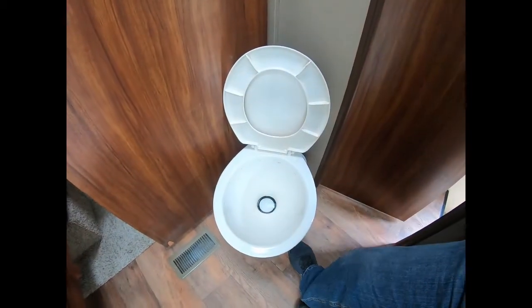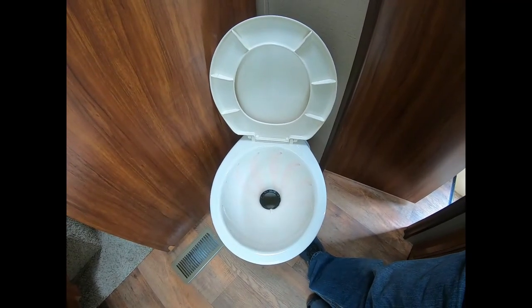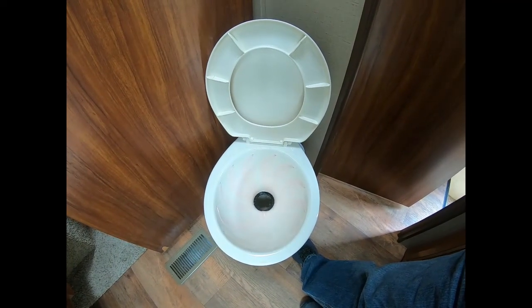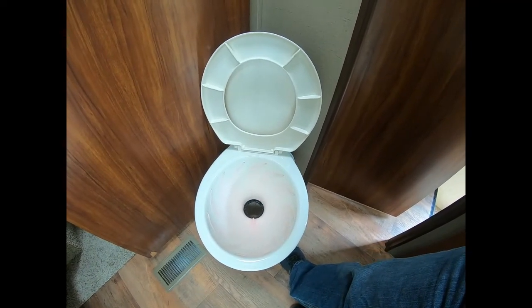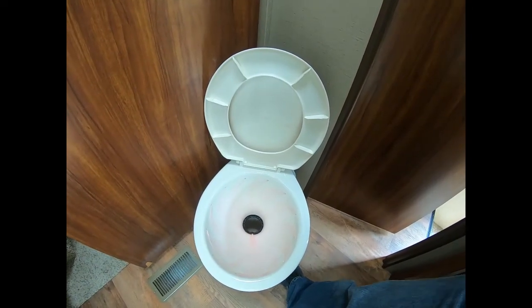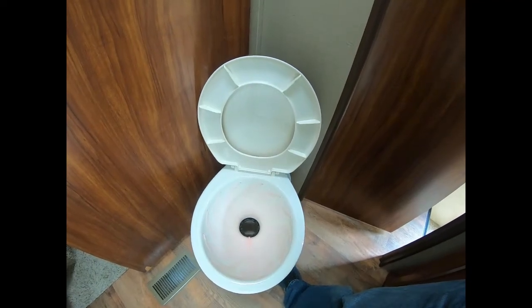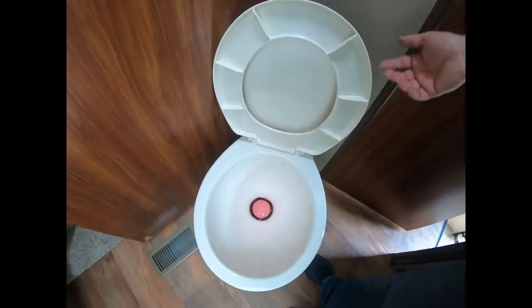And then next we'll do the toilet here. So, not much. Whew, it's clean. So, just the pump. Just enough. And then we got the antifreeze in our tanks, but usually I'll drain the tanks yet and leave the valves open over the winter. I mean, there's nothing to worry about when you're drained. Antifreeze has been already in. We can leave the tank valves open over the winter.